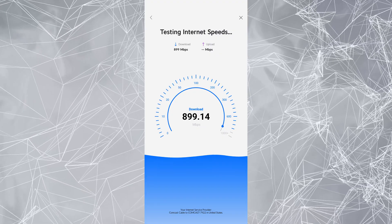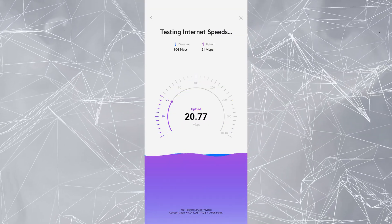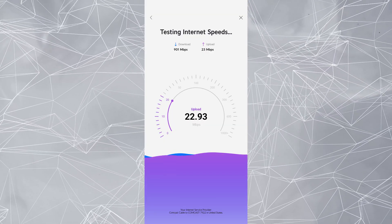Obviously super easy — if you've never had a UniFi device before, it couldn't be any easier. If you are upgrading from another device, you can back up that one and restore that config to this device; it works seamlessly. I chose to start fresh instead of restoring from backup. You can see from my speed test that I only have one gigabit internet through Comcast, but it is doing IPS and IDS on that and I'm getting really nice throughput. In 2025, 2.3 gigabit IDS/IPS throughput is pretty good. If you have higher needs — say a 5 gigabit internet connection — then I'd say go to the UCG Fiber over this. But for most people, this is more than enough throughput.